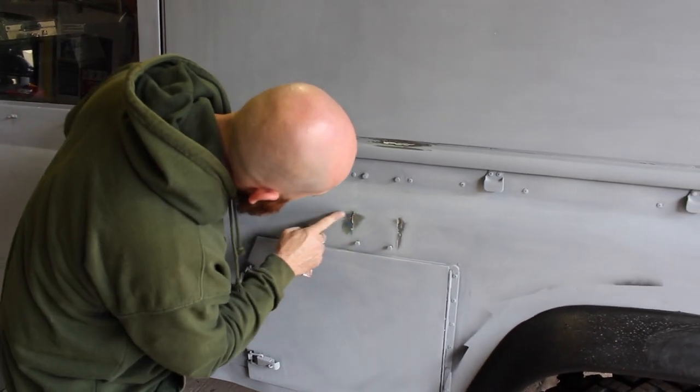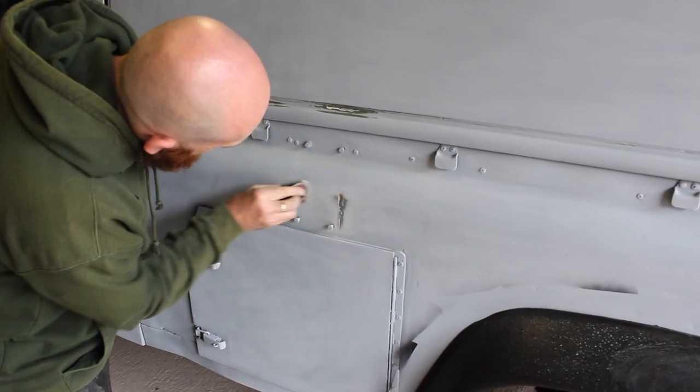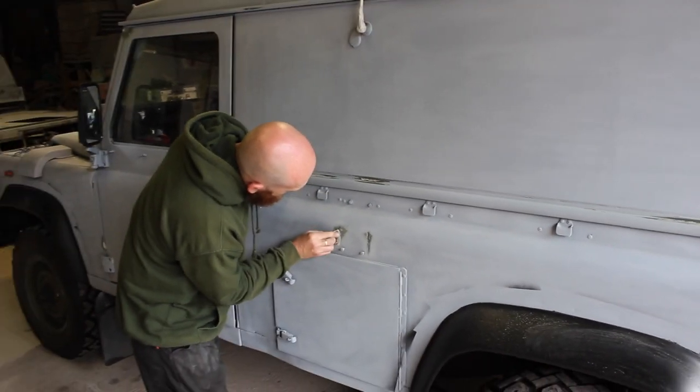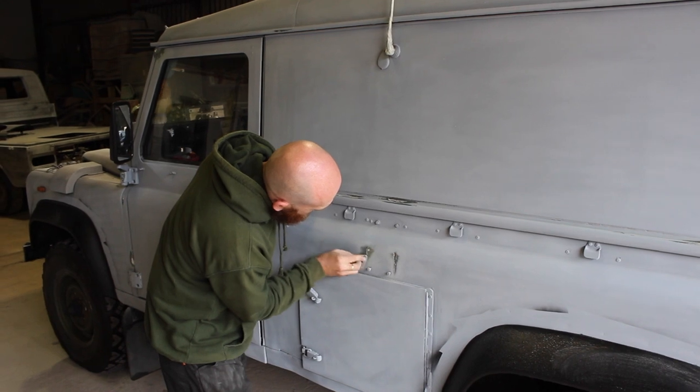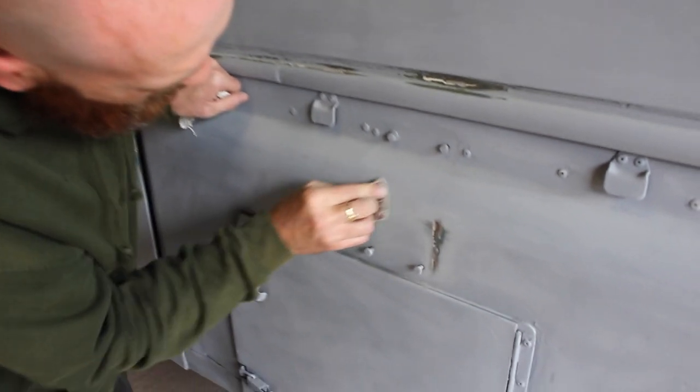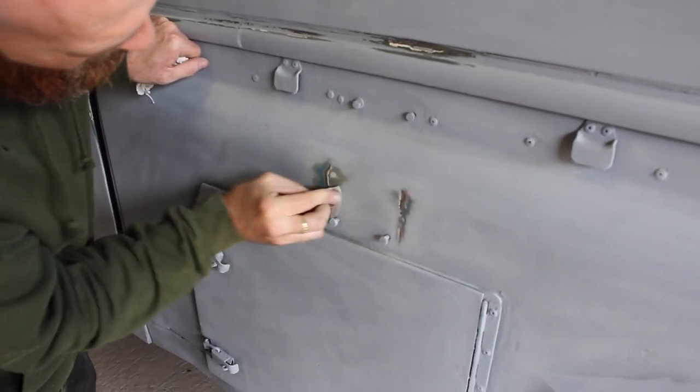The entire vehicle's been down, it's been scotched, rubbed to bare metal in quite a few places. He's gone proper OCD crazy with the primer and reprimed the whole vehicle. Now he's just etching it back up again, and any little points where you can see a line, he's just having another go.